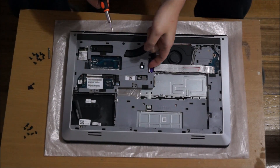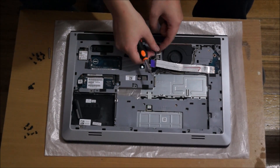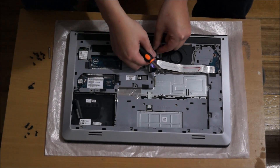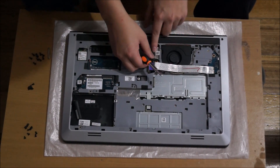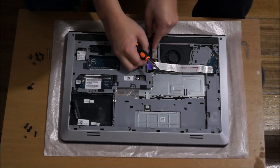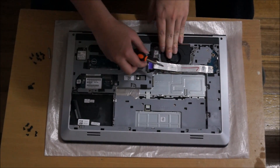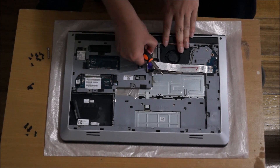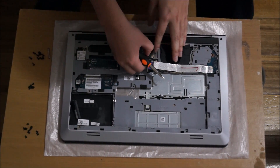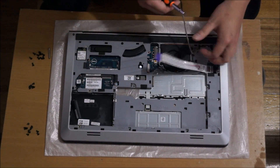We need to remove this cable — this is the extension cable for your side USB. And here's the LCD cable you need to remove as well. This is actually a bit difficult to remove. The design for this is flawed as it makes it ridiculously hard to remove. When removing the LCD cable and disassembling the back cover, remember when you reassemble it to re-align the LCD cable properly or else you're going to have issues with your screen.